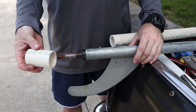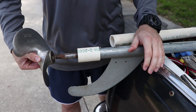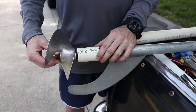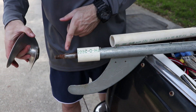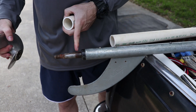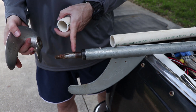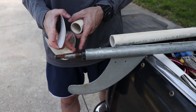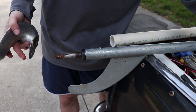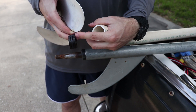This works for me, but not everybody can 3D print their own spacer. The issue is each prop will fit differently on this shaft. Like the hurricane props, they sit way far up here where you don't have much of a gap. You can see where this weedless sits because that's the one I run all the time - you got a good gap there. But with the hurricanes, they sit up pretty high so you're going to have to adjust this. That is the issue with this one - it's not adjustable, it's a set width. So I cannot use this with the hurricane props.